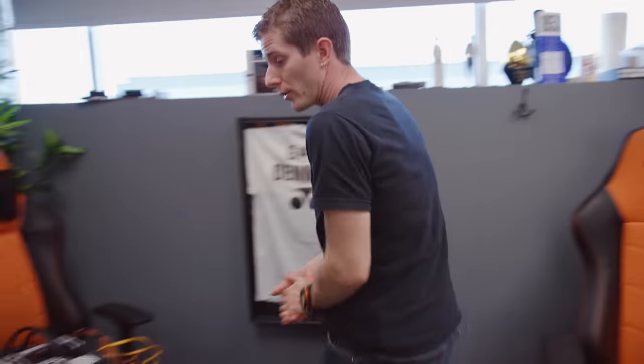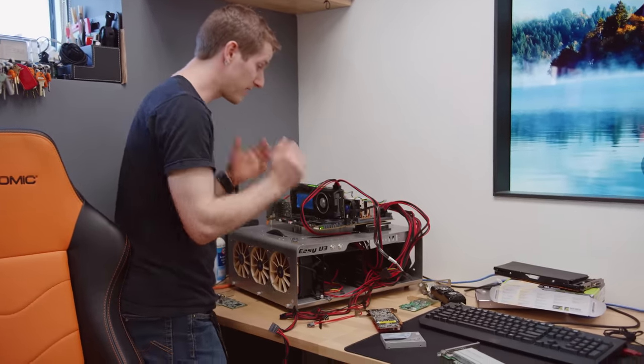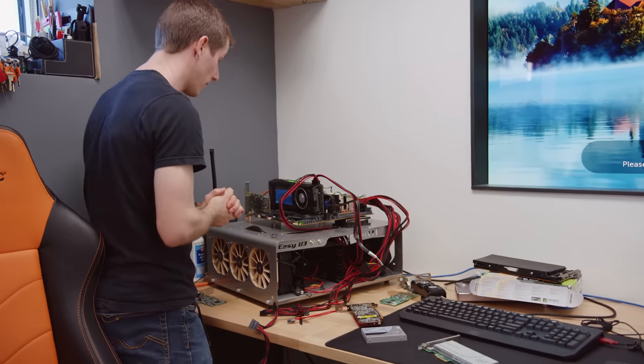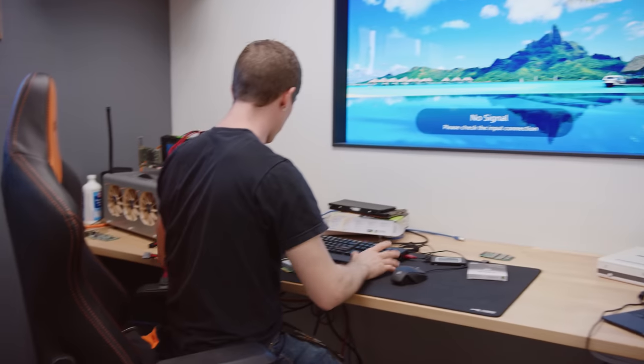So I am not defeated. Our wonderful contact at ASUS, Gary, has actually worked over the weekend. It turns out the feature's there on the board and it's exposed in the BIOS. It's not enabled. So they have provided me with a beta BIOS that should enable it. I actually wasn't that far off. The board is only specifically designed to support this hot plug functionality on the U.2 ports. So theoretically, when I flash this BIOS, it will enable or unlock that functionality.